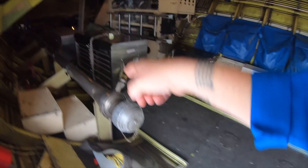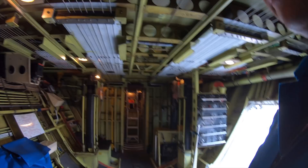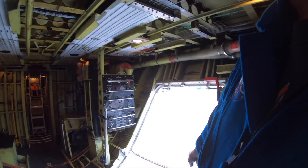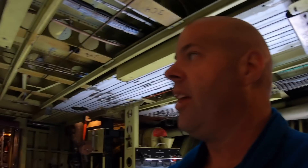We will connect that hose to that manifold, and that carries the bleed air out to each of the four engines for engine starts. Pretty cool how that works. Down here we've got the lower, unpressurized area of the Guppy — we are up forward. There's our main entrance door. We have our hydraulic panel that we use for all the hydraulic locks on the nose. We have our two stabilizing struts that came out of a dump truck, by the way. And we have all our flight control cables here. We physically unsnap all of these flight control cables when we open the nose. It's a little unsettling at first, but you get used to it. We have many sets of eyes that check it after they get reconnected, before we go flying again. If you're concerned for our safety, there's always a risk in aviation, but we do the best we can to mitigate it.